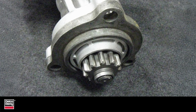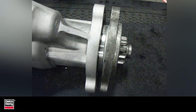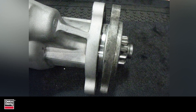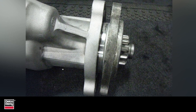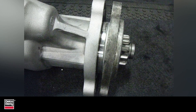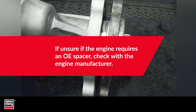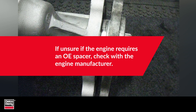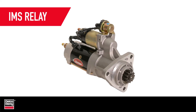Additionally, you may find that as you try to remove the starter, the OE spacer is sticking to it. This is not uncommon. That's why it's always good practice to check if the spacer is attached to the old starter nose housing before you begin. Finally, if you are unsure if the engine requires an OE spacer, or if it's damaged or lost, we recommend you contact the engine manufacturer for details.